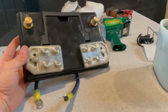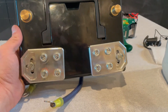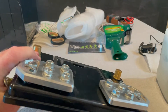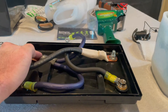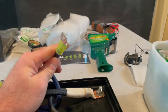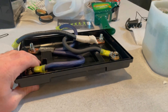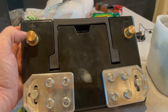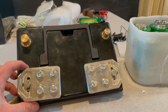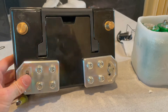We've also got this lid finished. I've got my two Sky High distro blocks on the top and they are jumped on the bottom. Here's from the distro block — we've got one of these four gauge wires going to the factory post and then one going to the super cap bank. Same on the negative side. That four gauge might not be enough, but I could always jump it again with a big one-off from here to here, which I probably will do.